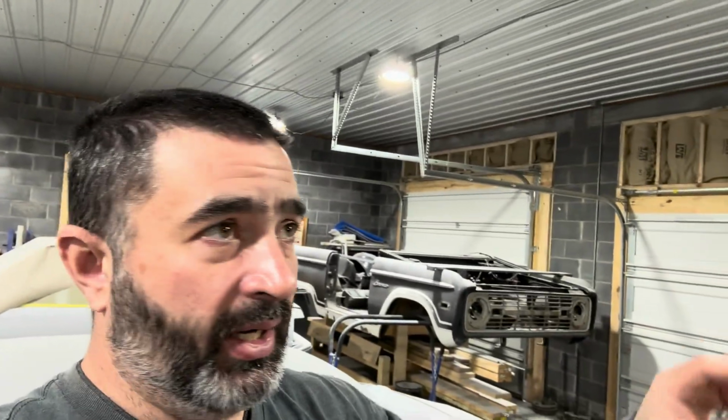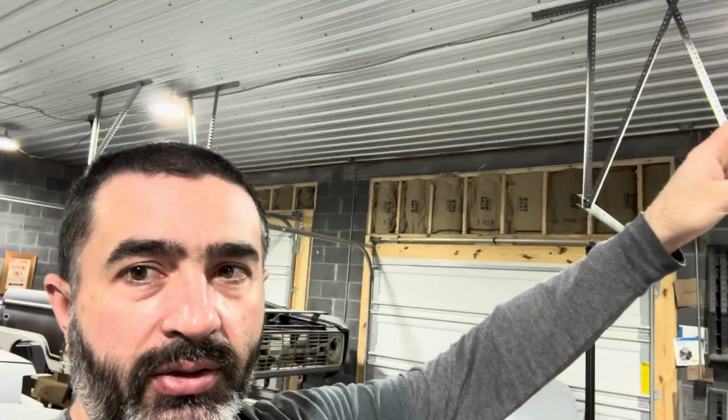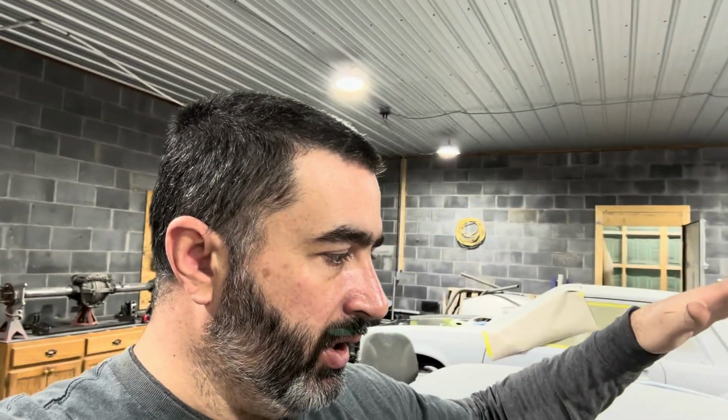I've actually been looking at them infrared radiant tube heaters that would go the length of the shop. That might be my best bet, is something like that, because it would heat the cars better than this style heater, because whatever is under that radiant infrared heater will get heated. So instead of blowing hot air around here, the cars, the metal and everything would be getting warm. So I may end up doing that kind of stuff since I have to buy one.